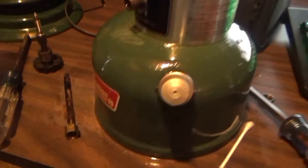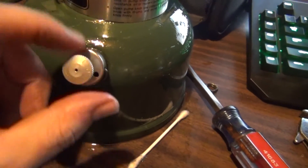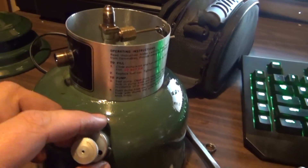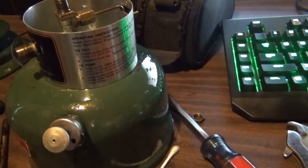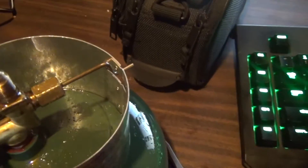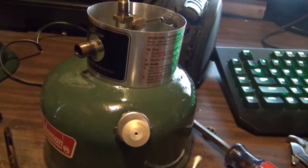So the generator is broken, as I said, and I'm going to possibly order a new one. I took out the pump assembly — that was quite simple, though I didn't get it on camera. It actually used leather to seal it, which was really interesting. My father had told me they use leather as seals, and I didn't believe him — now I do. I've gotten that all apart and sprayed some penetrating lube. I oiled the pump up and that works so much better — it actually pumps. And that pumps the fuel right through there.